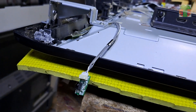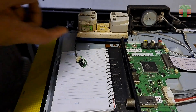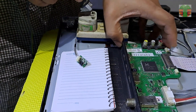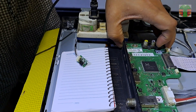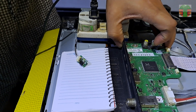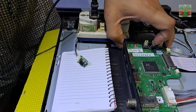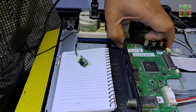To solve this problem, enter the TV into service mode and reset the errors. This is how to enter the TV into service mode: while the TV is unplugged, press the TV power button, then plug in the TV. Keep pressing the power button until the light turns from green to red. The category selection menu should appear.